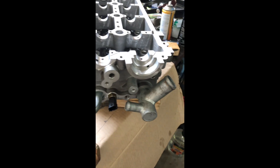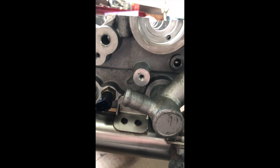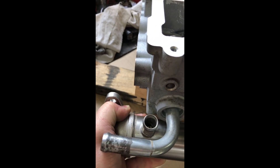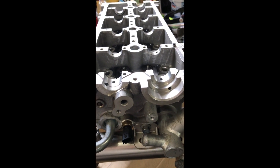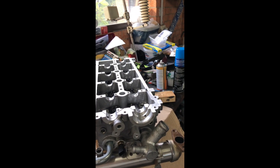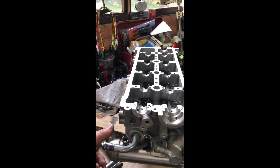Next to bolt up is the EGR cooler. There's a metric 10 bolt. The manual says it's got a torque of 45 Newton metres, and says not to tighten it until it's been connected to the exhaust and to the inlet. I tensioned it up to 45 and it's pretty tight — I can get movement out of it but it takes a fair effort. What I did notice is it can move sideways. That pipe there is flexible but the other one's not, so I think the best thing is to leave it loose until these flanges are all bolted up and then tighten it up.